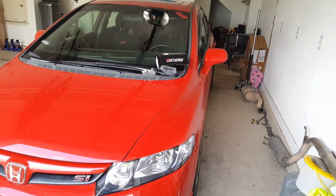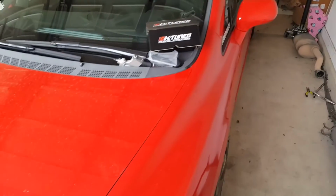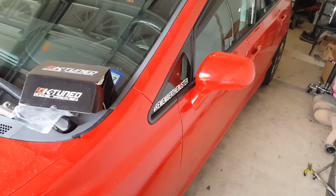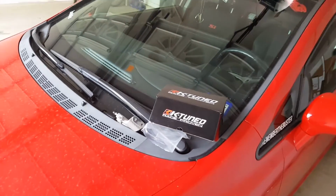And then whenever the tow truck driver actually came and picked it up, dropped it off in my garage, I couldn't do anything. All I could do was start the car. I couldn't put it into gear, take it out of gear, do anything. I mean, the clutch was just completely obsolete. And the reason why is because it was flexing, wasn't able to fully push to disengage and engage the clutch.